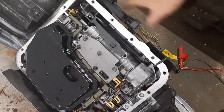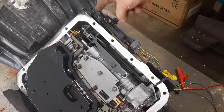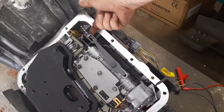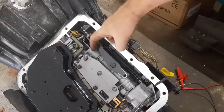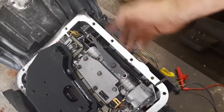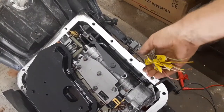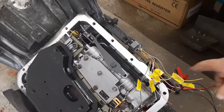To give you a quick overview of what happens when you shift your transmission: this is the linkage that connects to your shift lever. When you move that, this internal pawl moves and has a detent to lock it in whatever position you're in. That locks this cylinder internally to a certain position which tells the fluid which way to travel and which gear to go in. I'm going to test which wires are what when it's in each position, so I can splice it in correctly.